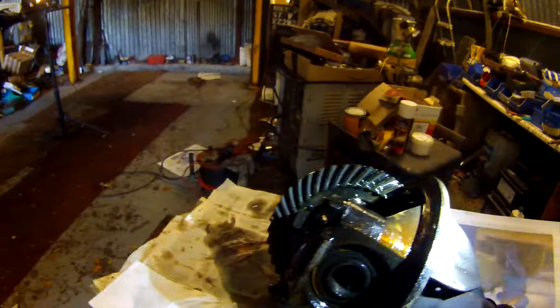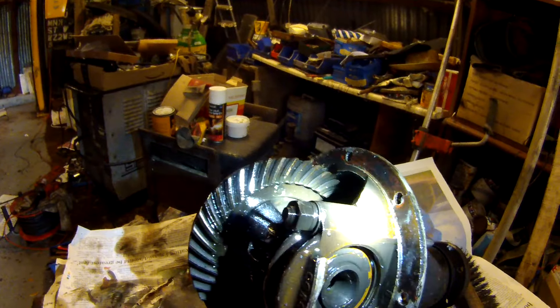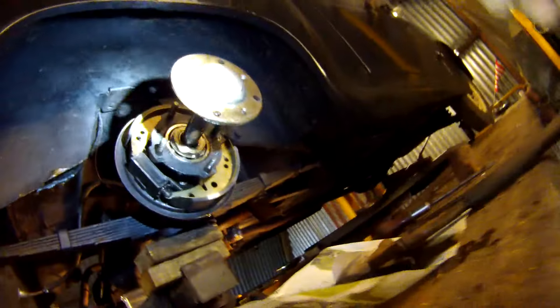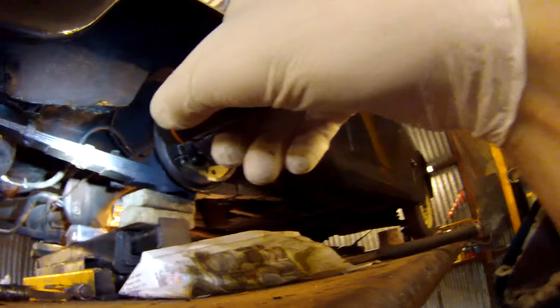It's quite a straightforward job to fit. The one we're fitting is probably ex-Morris Minor, later Morris Minor — bought it on eBay. One simply undoes the hubs and draws back the half shafts, draining the oil first.